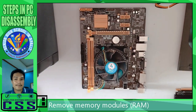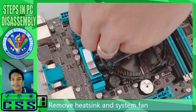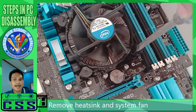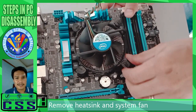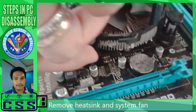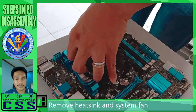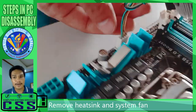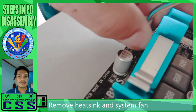For the final step of disassembly, we have to remove the heatsink and the CPU fan. So, we are going to remove it. Carefully, using our flat screwdriver, I just unscrew the plastic screw used on the system casing and system fan. So carefully, then we lift it. Slowly, so that the system is not damaged and we do not get hurt. Once we remove the system fan, we disconnect the 4-pin power connector. Carefully remove the 4-pin power connector. So we are now removing the heatsink and system fan.